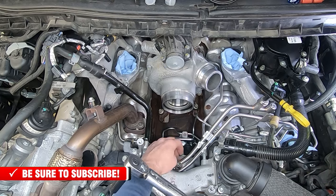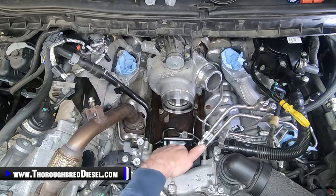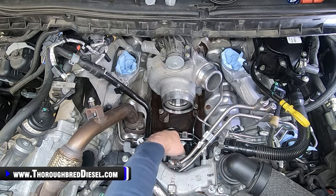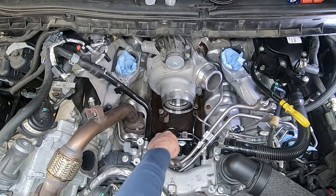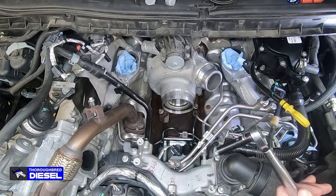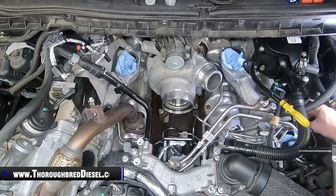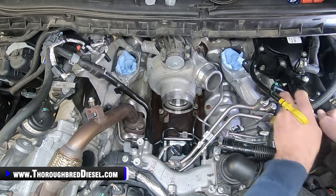Okay. All right, and you want to make sure that you get that seated in the DCR pump as best you can, or all the way down, because you don't want to draw that down with the bolt and risk cutting your O-ring. So I'm going to go ahead and hook up my DCR pump connection from factory here. You have a bolt over on the valve cover that we will tighten down to 89 inch pounds as well. Let's go ahead and knock it out here.